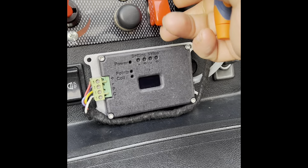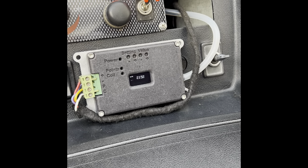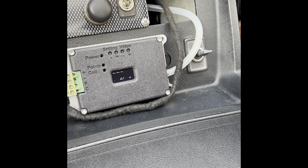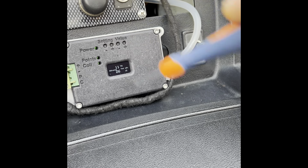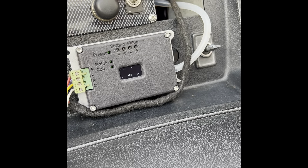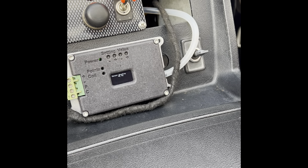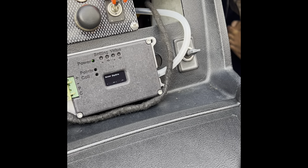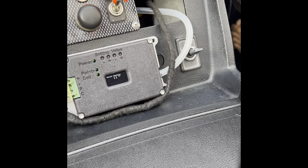To find out, we use the internal vacuum gauge. We start the car, and on the Blackbox 3 use the shortcut to vacuum settings — scroll through until we get to the vacuum gauge. That's now telling us the sensor reading is 11 — so that's how much vacuum there is on this setup at tick-over. As I gently rev it up it will drop down, usually to around or close to zero. Sometimes it goes up higher than 11 or 12 on the overrun, but basically we're working from figures of around 12 down to zero.